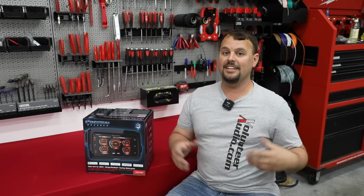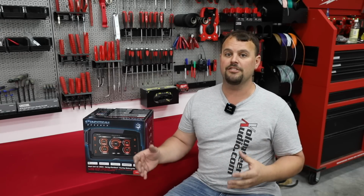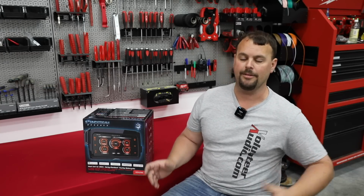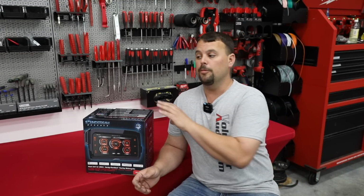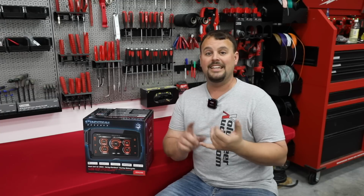With that being said, this is ADS or Idatalink's first time with a mass run of radios that have hit the market that use their Harley firmware. So there have been many revisions to fix some odd issues, and I'll run through those with you real quick. First, if you bought this radio on the original pre-order, a lot of places did pre-orders on it. We were so excited to get it, we did it too. And the first software that left Idatalink did not turn on factory boom amplifiers. It took about a week and they launched a revision that fixed that.